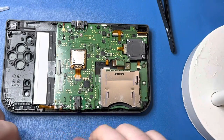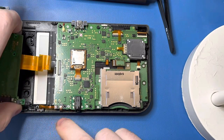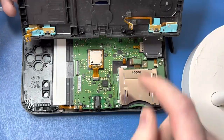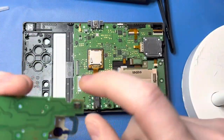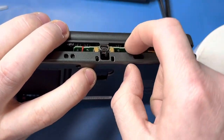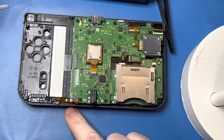That's done. The last thing to do is this one — put the new sticker on here, attach it into there, do the three black screws and then the five silver screws. I'm going to do this off camera so I don't make this video way longer than it needs to be. After that, plug this into here and this into here, and while holding it up, gently tuck it underneath so it doesn't pinch that cable, then gently snap it forward and do all those screws. And you're done. That's the video — that's how you get to the bottom of the New 3DS XL and clean out your buttons.